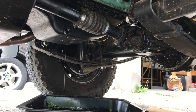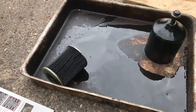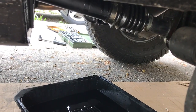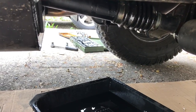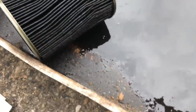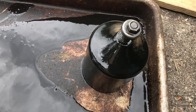I'm leaving that draining out for a while and now undoing the oil filter housing. The oil filter is out - it's a messy job, actually the first time I've ever done an oil change on this car. The front prop shaft gets in the way and catches all the oil draining from the filter housing, so there's a bit of spillage. Looking at the old oil filter it all looks pretty normal - no bits in it which is good. I'm going to clean things up, fit the new seals and put it back together.